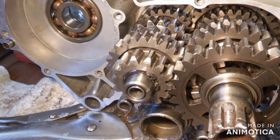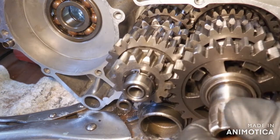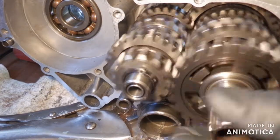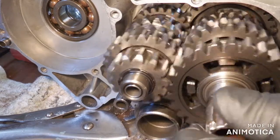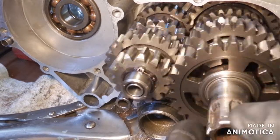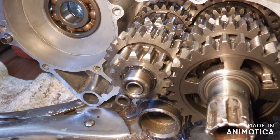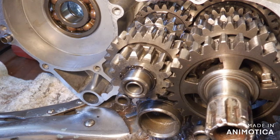Transmission is at 4 o'clock on the shift drum, which puts it in first gear. Watch this little shift drum and you'll see it move. There's neutral at 5:30. There's 2nd, 3rd, 4th, 5th, 6th — see where that moved up. It shifts very smoothly. I have no idea why it wouldn't do this in the left engine case. Make sure you keep your fork shafts secure. That's what it should look like.